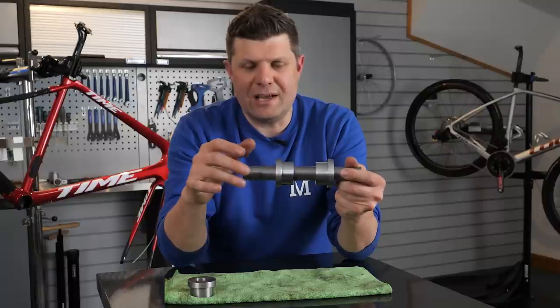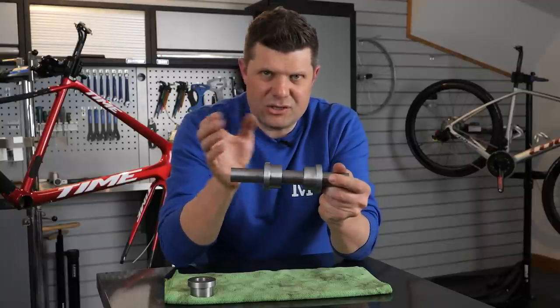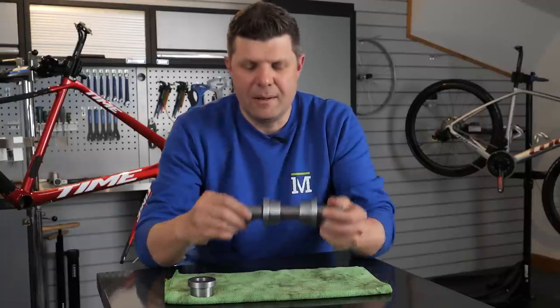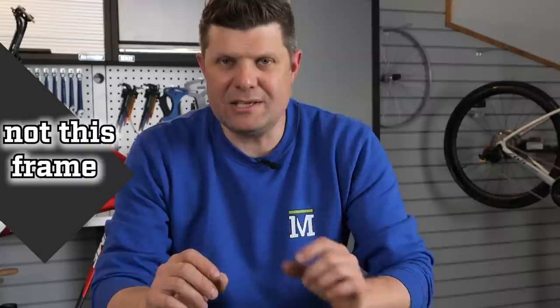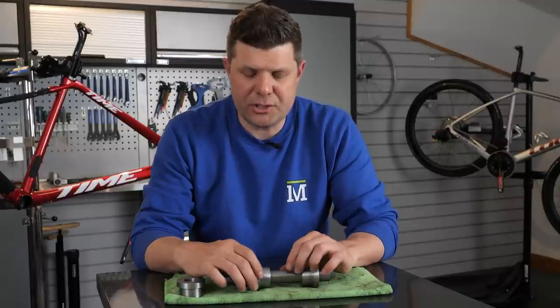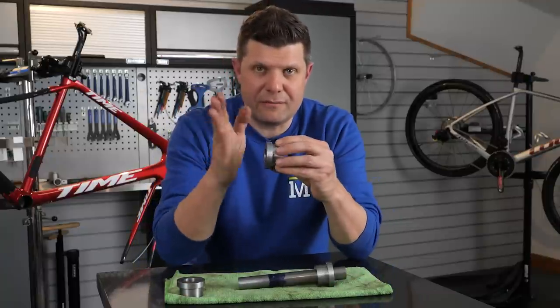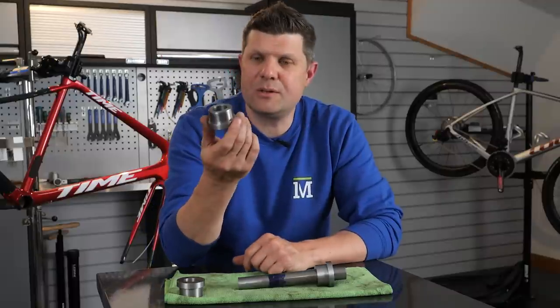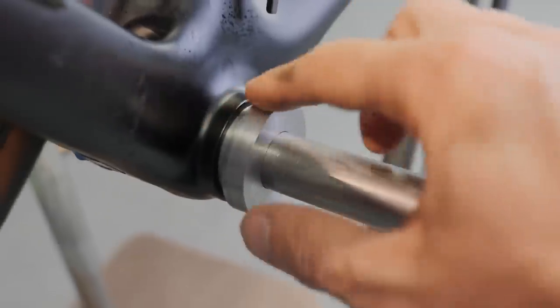We put this through our 25mm bright bar and we should have a fit-up similar to a C3 bearing fit, which should spin freely. You'll see in the video that it doesn't, even though it should be faced up to the frame. Please don't criticise — these are prototypes. The purpose of this video is to help explain and visualise what under rotation means, and this frame had such good symptoms it was too good an opportunity to miss filming.